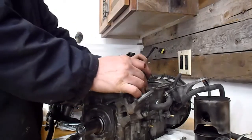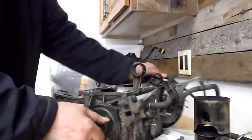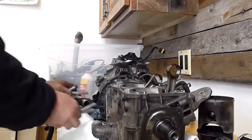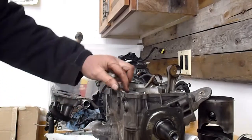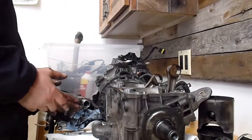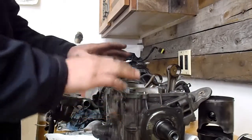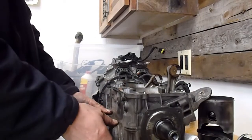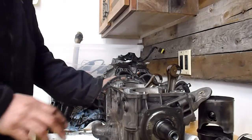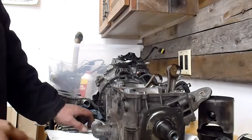This still saved me money rebuilding it myself. It doesn't take long to tear an engine down once it's out of the chassis. The time consuming part is going to be cleaning everything — cleaning all your surfaces off. This uses O-rings on the head, so there's only one big gasket on the base here. But I will have to put a new gasket on the water pump housing. I've got to get the flywheel pulled off yet, get this bearing retainer off, take all the bolts out of the case, and then split the case.